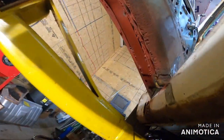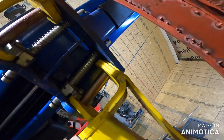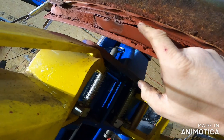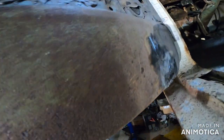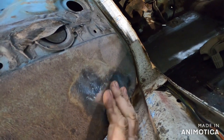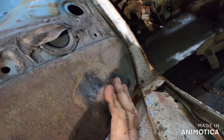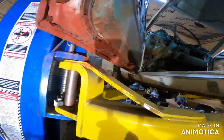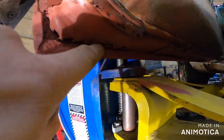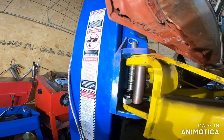I am going to say this turned out extremely budget. I'm going to show you a before and after. This atrocious mess — remember, this is what we're sealing. That's before. This is with the plate welded on. That right there didn't turn out too bad — a lot of grinding. I ended up all the way up here with pinholes after I started welding and punching through. So I'll have to sand that down and paint it, but that's okay — it was going to get painted anyway. Right here, see all this? We're not going to weld that because we have been burning holes through stuff like you would not believe. The doors are thin — the metal was thin from the factory.